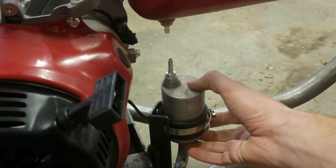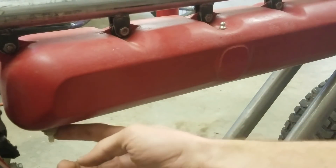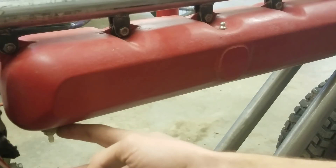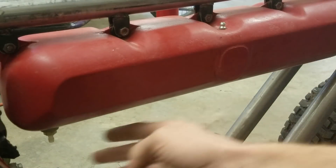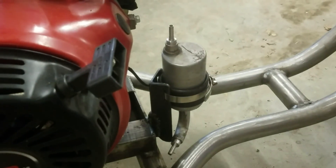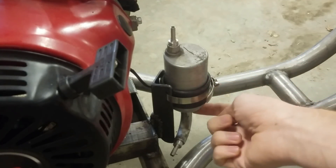The reason is because the fuel tank I have here has this flat bottom and the outlet is on one end of it, not in the middle. So I'm worried about if I'm going like down a hill, the gas will shift to the front of the tank and then not back here, so this will just be sucking in air from the fuel pump. But if I have this in there, this will hold some amount of gas always right here.